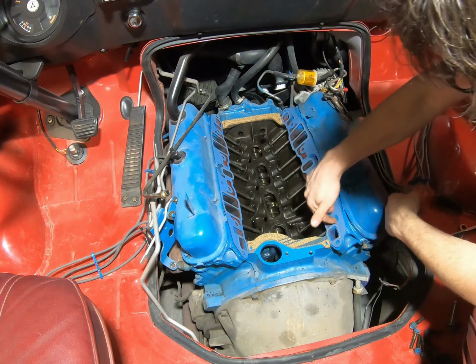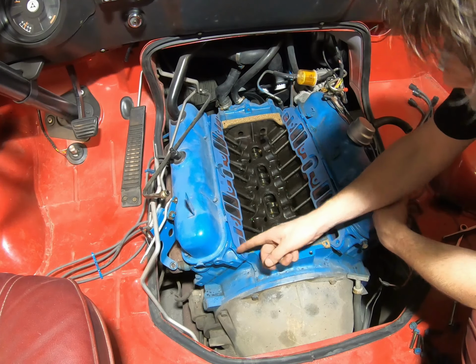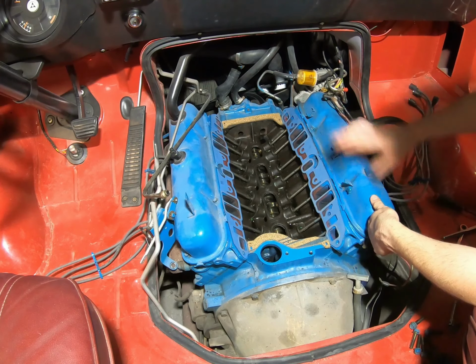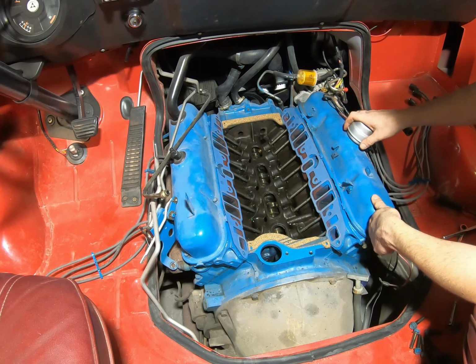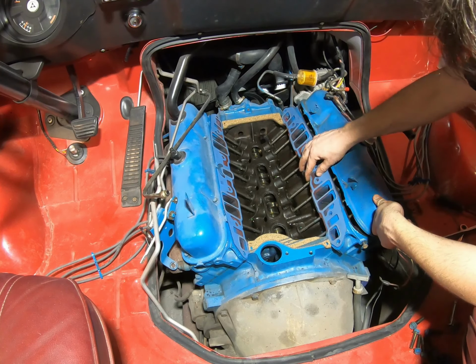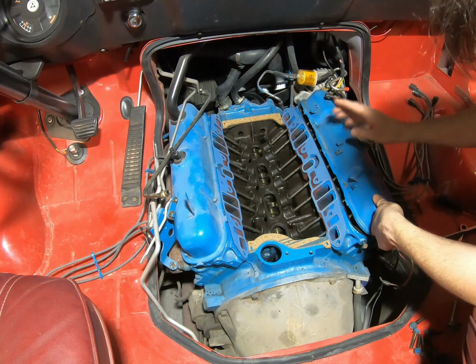And they also help hold these gaskets up if you don't have the little push inserts to lock them into place. Now, one thing with these gaskets that you might run into is sometimes you have to take the valve cover completely off on one side, if not both sides. This one I was able to just loosen to where I have these two screws out, and I can just tilt it back and set it up in there. We'll be able to set the intake down in there, and then this can kind of clamp back over top of it.